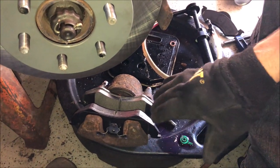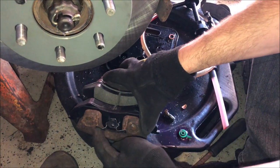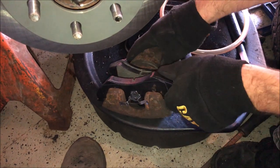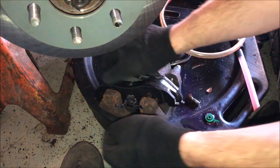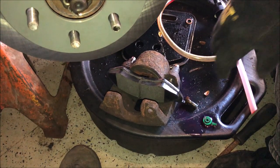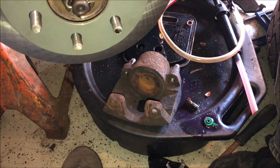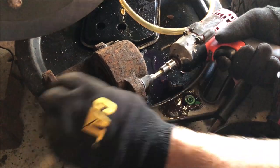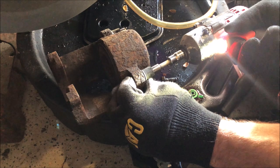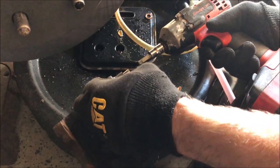If you're going to reuse your old brake pads, make sure to remove them. For the outer pad it has clips — push in toward the center of the caliper and then lift up, because it has an alignment dowel that seats in a hole. The inner pad simply pushes straight over with clips. Now remove the slide pins the rest of the way — they just get hung up on the rubber, but you can push or pull them through.